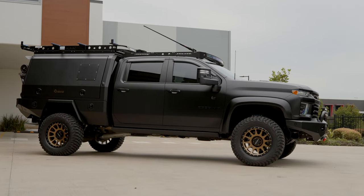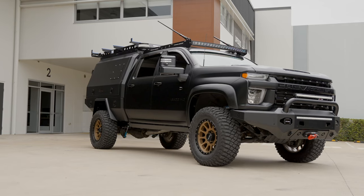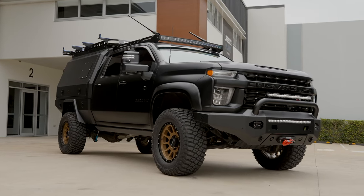This one here is a little bit different — we've kept it nice and low, we have gone wide, we've got big tires. What comes with that is a lot of trimming and a lot of modifying to get the wheels to turn inside the guards. But this thing looks wicked — it's got a two to three inch Kings lift with Super Lift upper control arms.